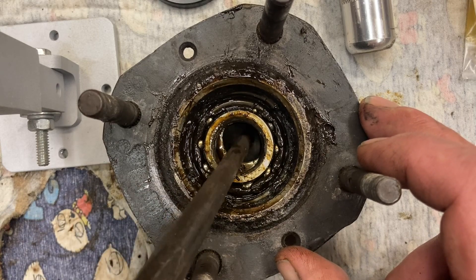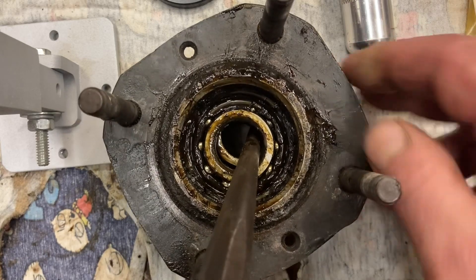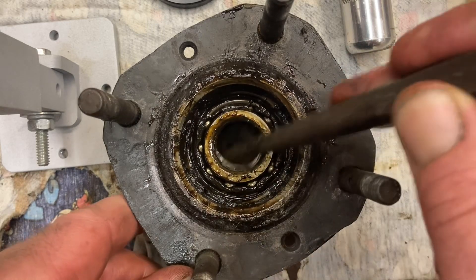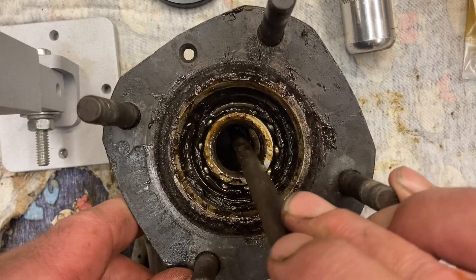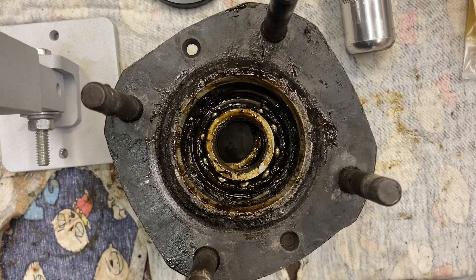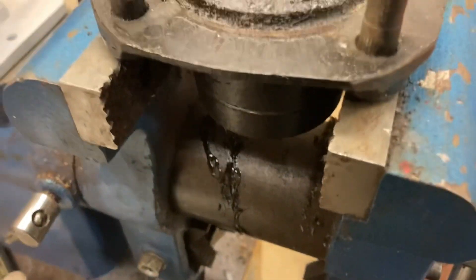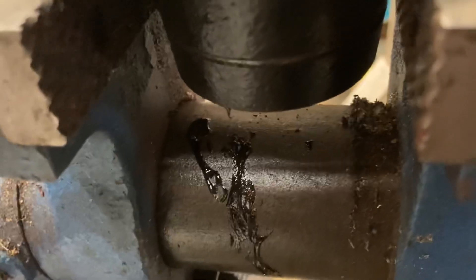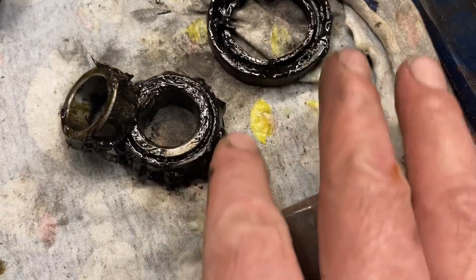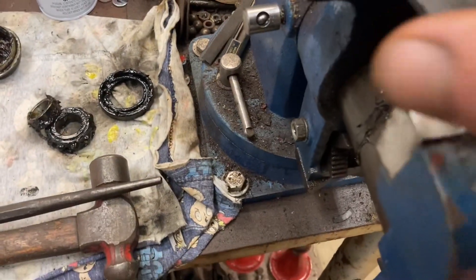To get the bearings out, move that center collar over so you're not hammering on it, then hammer on the bearing — the inner or outer bearing — tapping on either side. You'll probably have to drive it on all four sides. Keep moving that spacer over, hit it a few times on each side, and work slowly. Don't work one side too long — keep moving back and forth. It's easier to put it in a vise so the hub isn't sitting on a table and the bearing can come out. After hammering, here's the original bearing, the seal, and the center spacer — all greasy, of course.